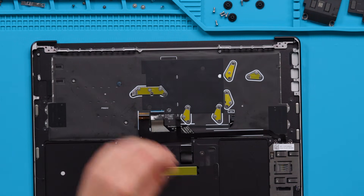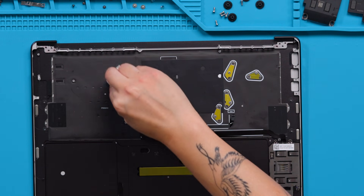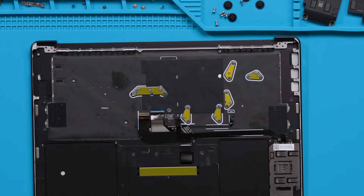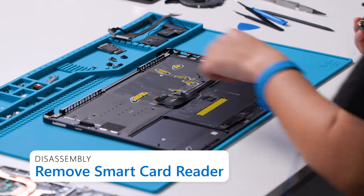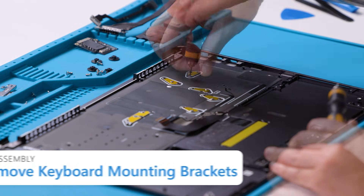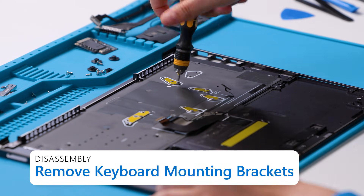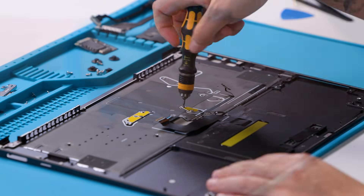If you are reusing the motherboard, clean off all blue thermal grease material using IPA and cleaning swabs until all residual thermal grease has been removed and the surface is clean. Remove the smart card reader screws using a 3IP screwdriver. Remove the smart card reader from the keyboard assembly. The next process is needed for keyboard replacement only. For this repair, you will need to remove the mounting brackets on the keyboard using a 2IP screwdriver.